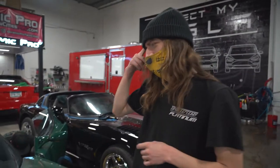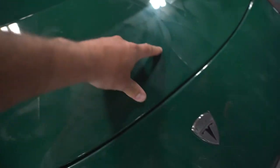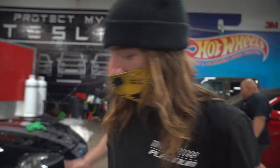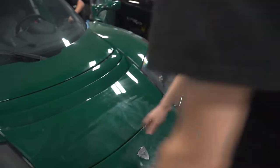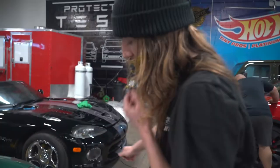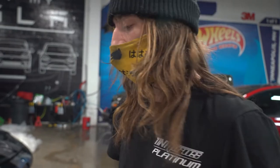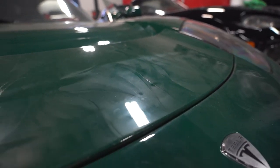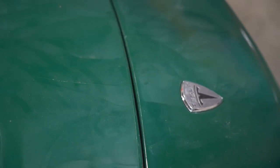13-year-old PPF adhesive. It's 13-year-old Clear Bra adhesive. And that doesn't come off. It doesn't really come off. You have to, like Ryan said, spray a ton of adhesive remover on it. And then you put a plastic bag on it and let it sit for like 10, 15 minutes. And spray it off. 99% of the time that works. 1% of the time it doesn't. If that doesn't work, then prepare your hands because you're going to be scraping a lot of it off with the plastic razor blade.